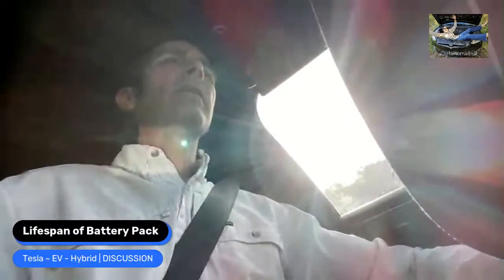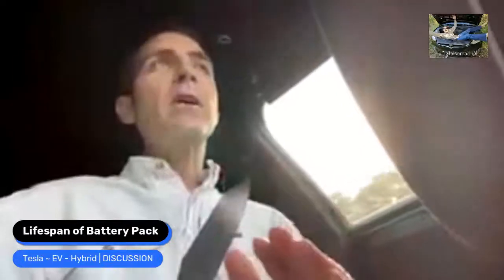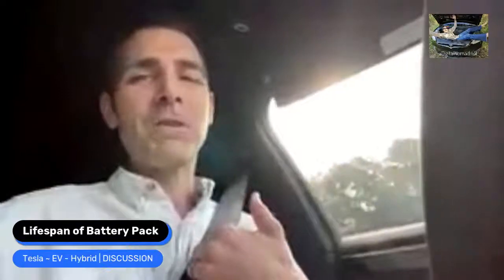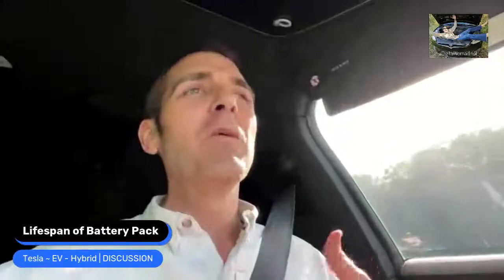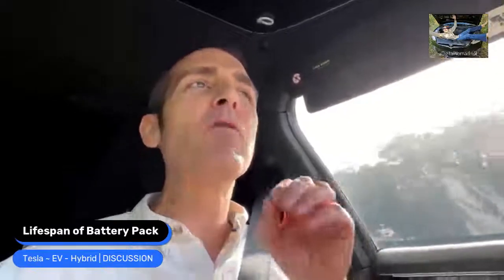Battery packs, life of the battery packs. Heating and cooling. That's a big deal on a lot of electric vehicles before Tesla. Okay, now Tesla has always had on their battery electric vehicles heating and cooling systems that are dedicated for the battery pack. Now, if you're old like me, because I'm 51 when I'm recording this video, you remember a time when you could buy Japanese cars that didn't have air conditioning. It was an optional dealer installed extra, or any car that didn't have air conditioning. Well, you can't have a Tesla without air conditioning. You know why? Because it cools that battery pack when you rapid charge it.